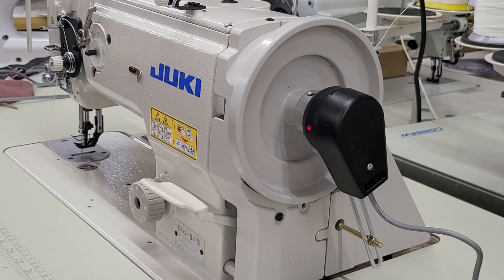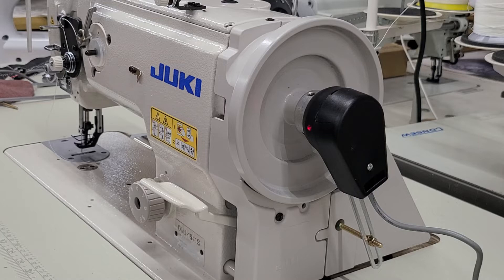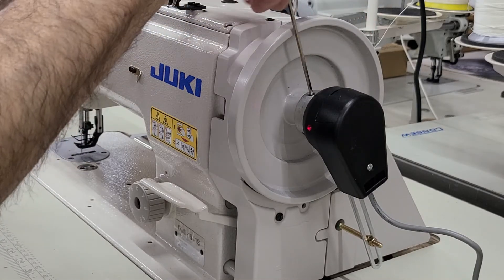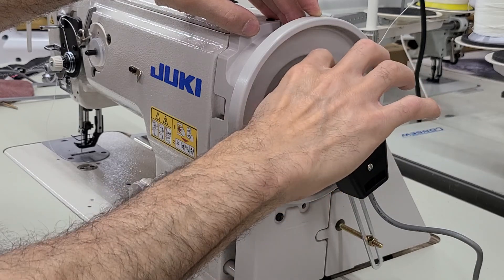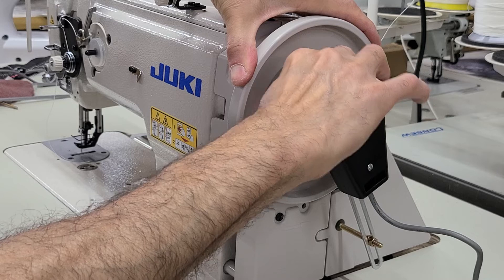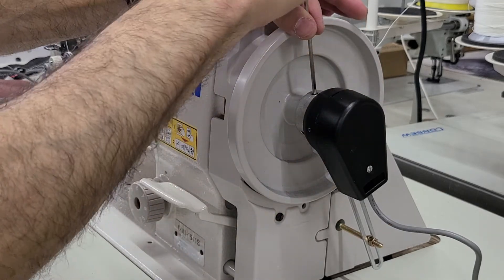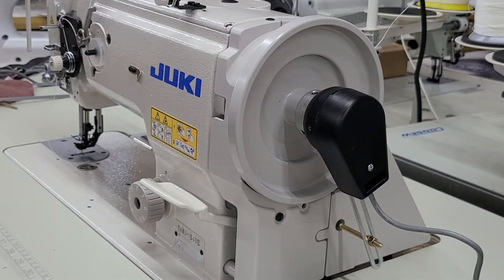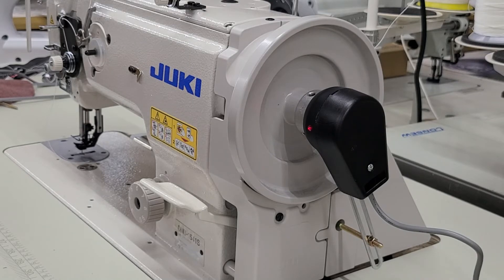Once you push it, it should program it — up is up and down is down. I've got it set to down and it's not quite stopping all the way down. So I'm going to loosen that screw that I tightened. I'm going to hold this silver piece — not the positioner itself, just the metal part of the positioner — and turn the wheel to get it to my down position. It's not going to always be perfect, so you're going to have to make little adjustments. It's a little bit of trial and error.